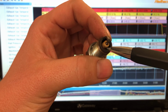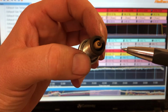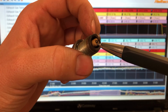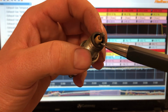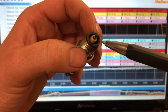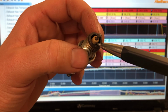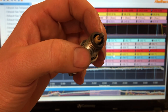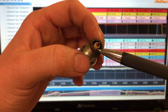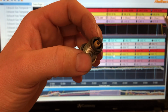This gets a little hard to read because of the candy in the fuel, so it discolors it. But what you really want to look for in that is any speckling. If you see little black speckles on here, that's actually oil that, when the engine detonates or starts to detonate, splatters off the bore onto this, which is really hot, and it burns on there and leaves a little black speckling mark. So that's a little sign that you're starting to get detonation. If you start to get silver speckles on there, you are detonating and you're taking little shards off the top of the piston, and it's sticking to this, because this electrode here is the hottest part inside.